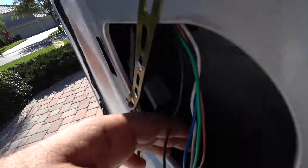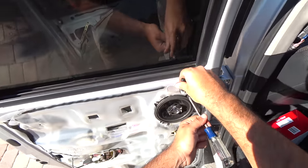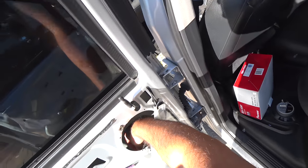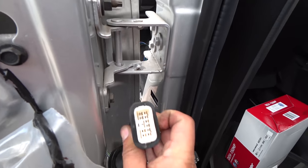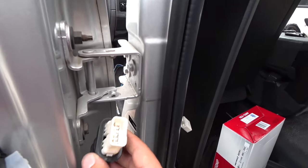I'll drop the camera inside so you can see. You have a little attachment coming from the rod to the lock itself with little set screws to lock it in place. Just kind of bend it around until it gets somewhere that you can use. The hard part, of course, is keeping it out of the way of the window. This lock is going to be interesting because it's a completely different setup — it actually goes vertically this way and then up. We can even attach it here behind the speaker, it'll be nice and easy. The door jamb wiring harness isn't just rubber on both sides — it's actually got a connector that does the door ajar switch. So I've got to figure out how to get some wires through here.